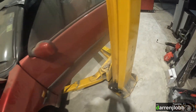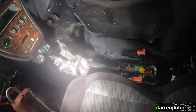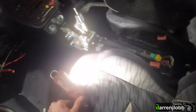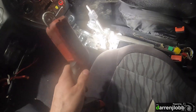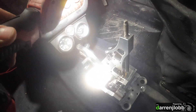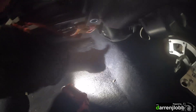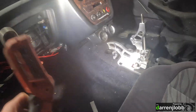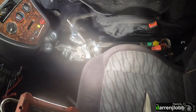I haven't actually mounted the shifter yet. I've been inside and torn out the trim from the centre, taken out the factory gear shifter, and just positioned this aftermarket job so the centre of where the shifter sits is exactly where the OEM one was. You can see the cables come in the front there. The aim is to come in around about there with the cables and hopefully they'll just sit underneath the dash fairly out of sight. I'm not quite sure how it'll clear the factory centre console but we'll just make it fit as best we can.